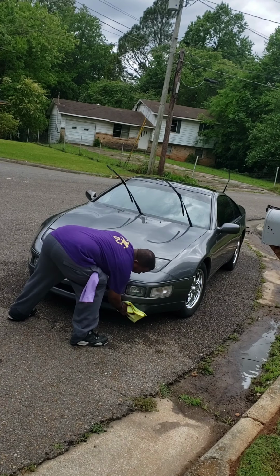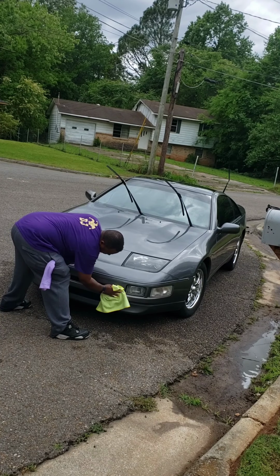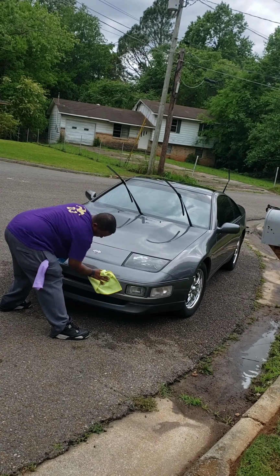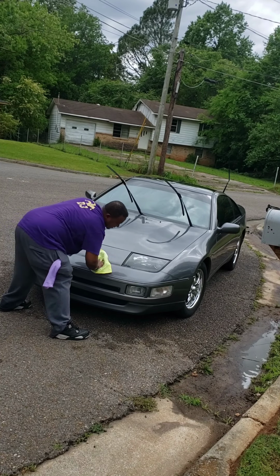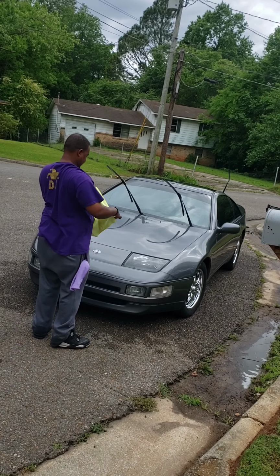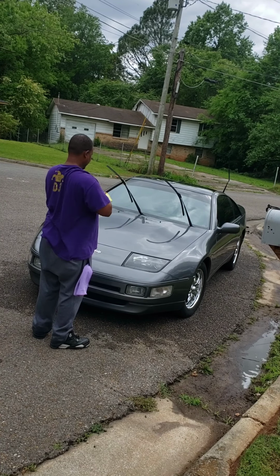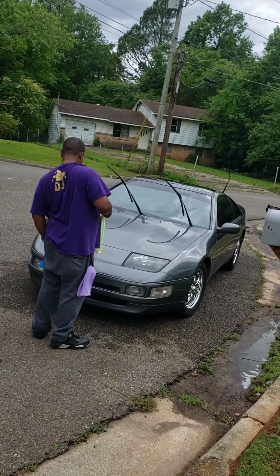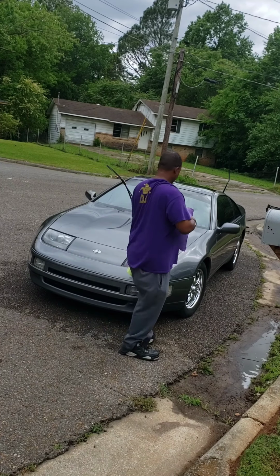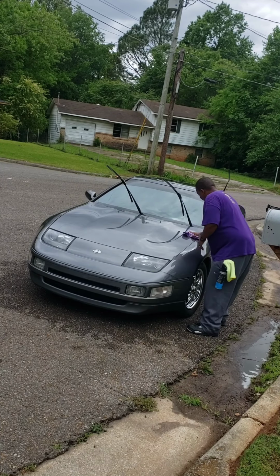It's also a pretty forgiving coating, because I once did encounter a high spot and I was able to level it simply by applying a little more and dabbing it on the surface until it rehydrated that area. Then I was able to level or wipe away the excess. So if you were to apply this and then see a high spot the next day, don't panic. Just pop your coating back out and level it back out.